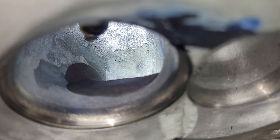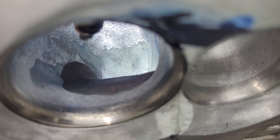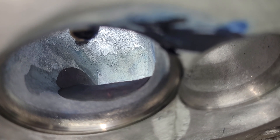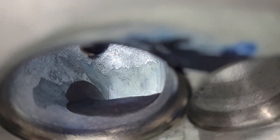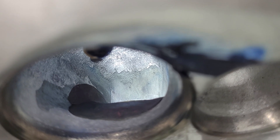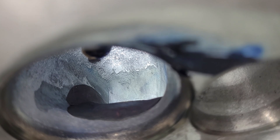I did fill up the cylinder wall side — remember I put a half-inch ball on that wall and flow went up five CFM. That was after the owner said he filled that wall and got an extra 10 CFM, which is interesting because it had high-speed air on there. I keep thinking of those EQ magnums I just did — that crazy roof design where the roof was real narrow and the short side was real wide. I keep thinking of that when I'm working on these.